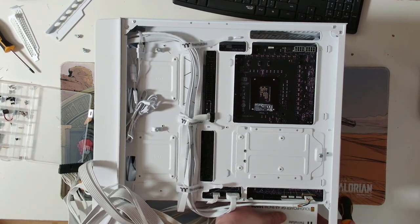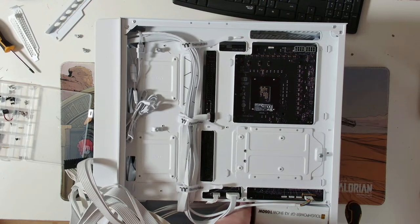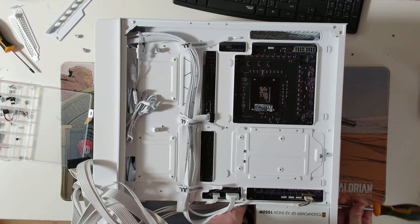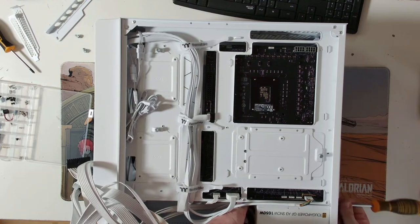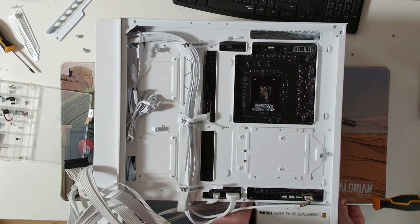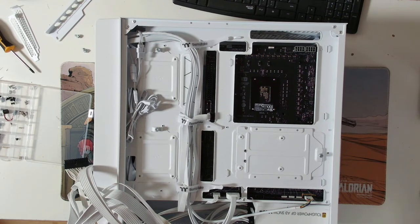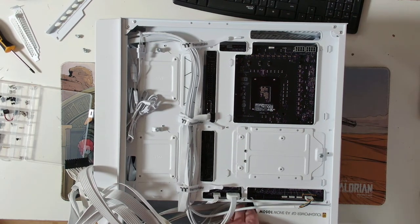If I bought an RTX 4090, will I have to buy a new PSU, or can I use my old PSU? Depends what PSU it is. What size, what model. I wouldn't want to use a 4090 without using an ATX 3.0 power supply.